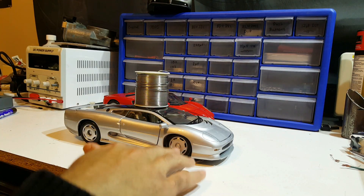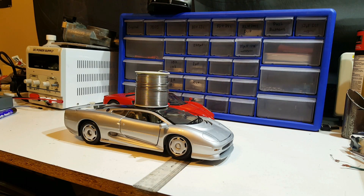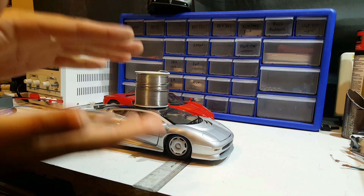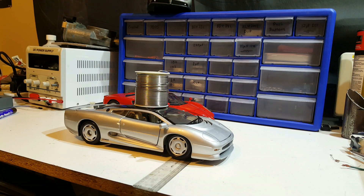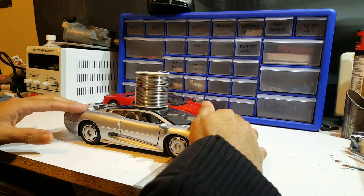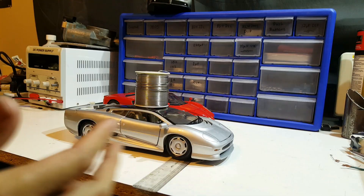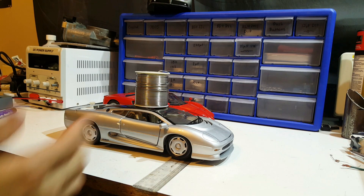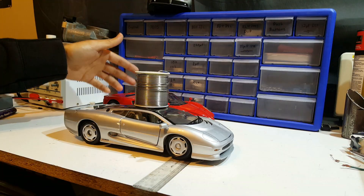The only difference is that the wheel over the bump has gone slightly higher, and obviously it will have more load on it because the spring has taken the weight — when you compress a spring it also puts more load on the tire — but still all four tires are on the ground and all four tires have some weight on them. The weight is more or less evenly distributed over all four tires. The softer your suspension, the more evenly the weight is distributed on all four tires, and the stiffer your spring rates, the closer it goes towards the Enzo situation.